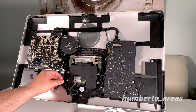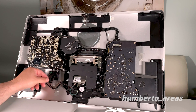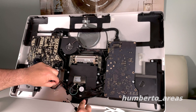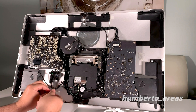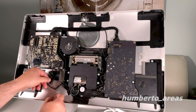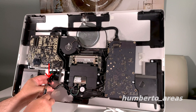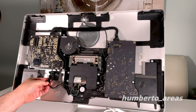There's some adhesive tape here holding those cables in place, so go ahead and get that tape out of the way so you can fish out the cables — specifically the MagSafe connector. Go ahead and unhook it; it has a little clip that you have to press. Press on that clip and pull it out gently.